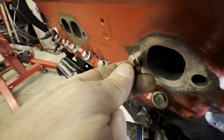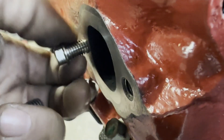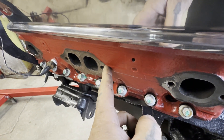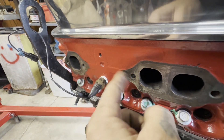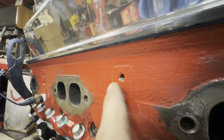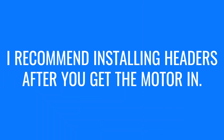I ran this bolt in a couple different places and that's too close - it's bottomed out. It's too close to the thickness of that flange, so it'll probably bottom out. I don't want to risk running it that long, so I'm not going to use these ones - I'm going to use the shorter ones. Another thing I should probably do is this whole surface here is a little thicker since I painted on this brake paint. I gotta clean that off because my header won't quite go in all the way, so I need to remove that up in the area where the header is gonna seat. I'll just take that sanding wheel to it.